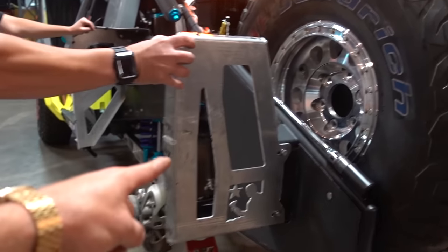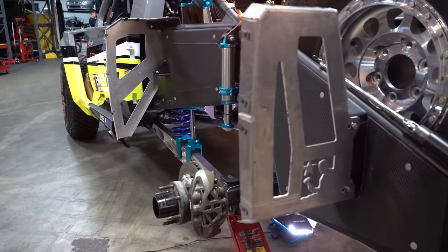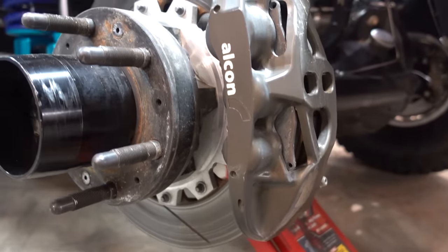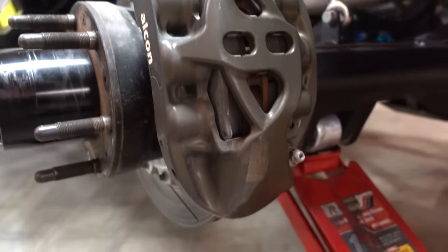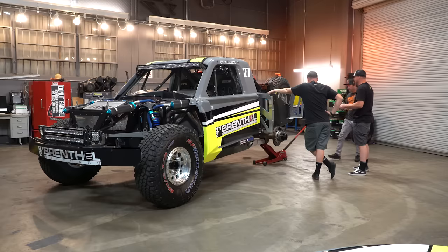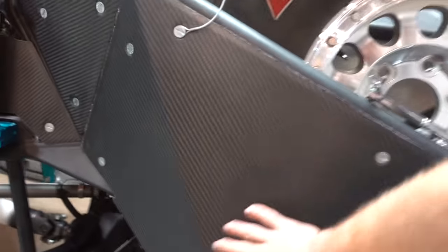First thing — we've got these aluminum bedside mounts and they're made to be a breakaway point, because in off-road racing you beat stuff up. Moving on, we've got massive brakes here. Alcon brakes are pretty cool because they're the only brakes actually designed for a trophy truck. Other brands use something from a road car or other program, but these were 100% designed for this application — and they absolutely are the best. We've tried every kind of brakes out there. It's a significant performance gain. The truck stops like a road car even with a lot of weight, big tires, and dirt.